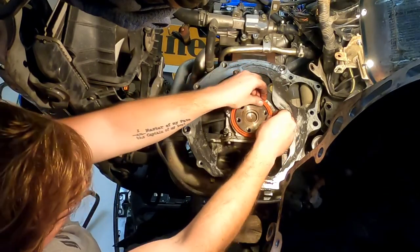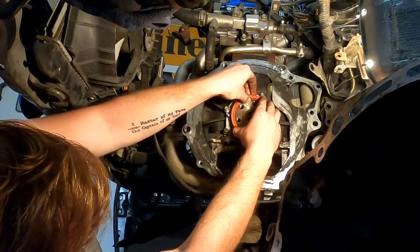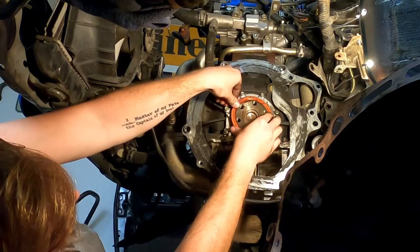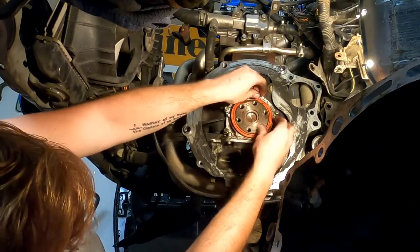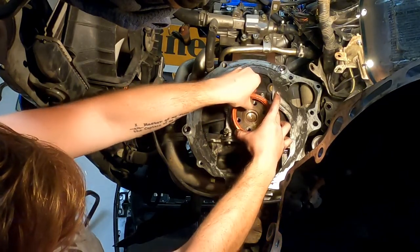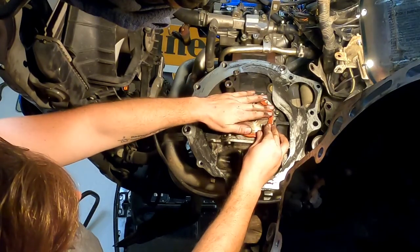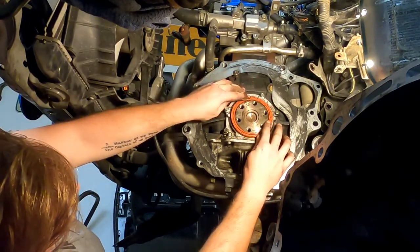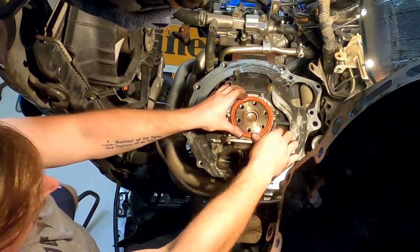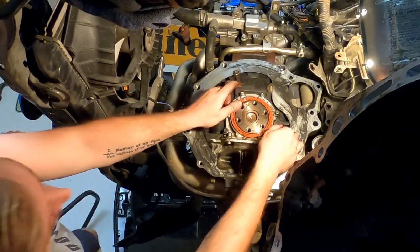When you install these, you want to make sure that you put them in nice and level, perpendicular. Don't go in at an angle like it's trying to do. That's how you hurt the seal. They make a full installer for these type of seals. If you do it patiently, which I'm very bad at,